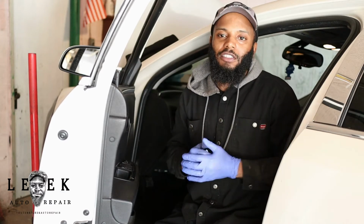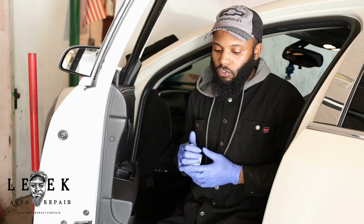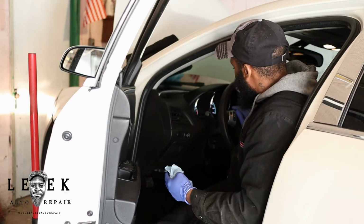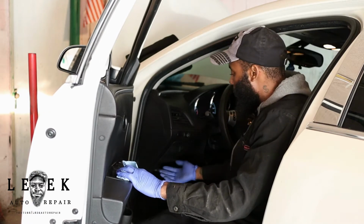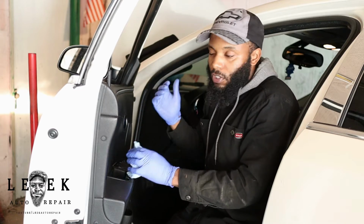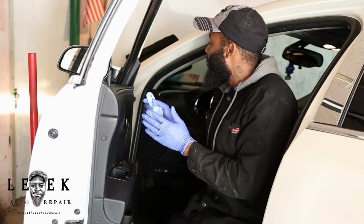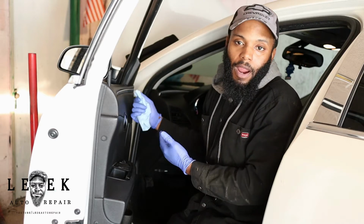So I'm working on a 2012 Chevy Malibu. No matter if it's a 2.4 or 3.6 on this issue. If you've been following my story, I put in my story that this car has an issue with the horn not working. As I'm pushing it right now, the only thing I hear is the relay clicking, so that probably lets me know that I've got power. Usually when I get problems like this, I directly check the fuse, if something just doesn't completely work. But me having power at the relay probably lets me know there's probably power at the connector.